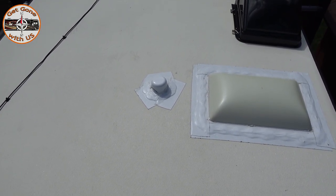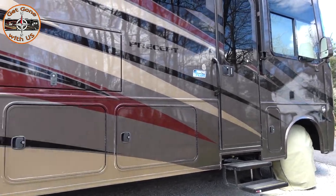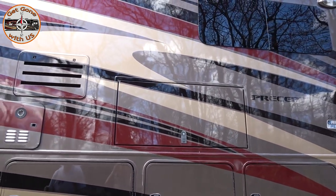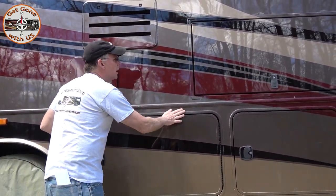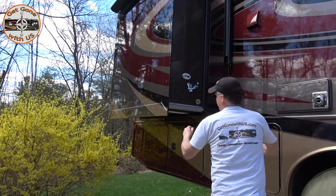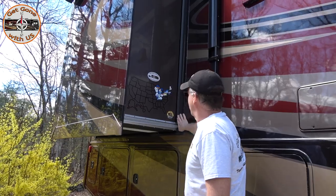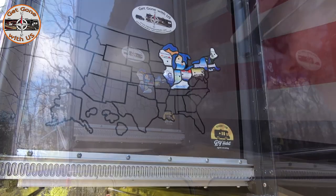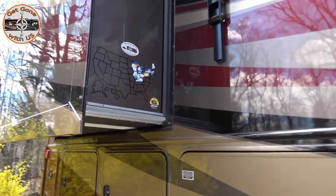After the roof, we're going to do a walk-around the exterior. As you're doing your exterior walk, you're looking to make sure everything is how it was when you put it away — none of the windows are broken, and anywhere there's sealant you want to check it and make sure it's still well sealed. If not, reseal it. Especially check those T-rails. Check your seals for your slides, and make sure you didn't lose any. Run your slides out, but you don't want to run your awning out.